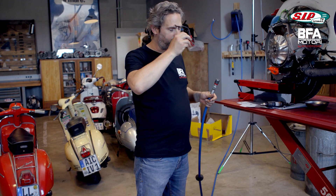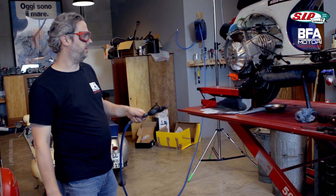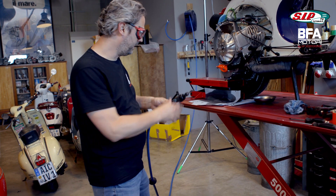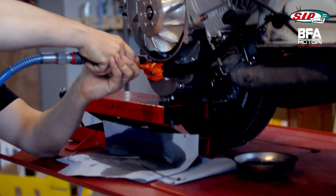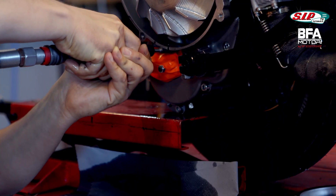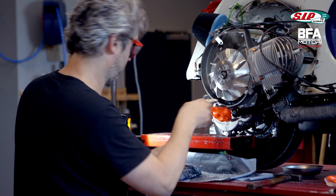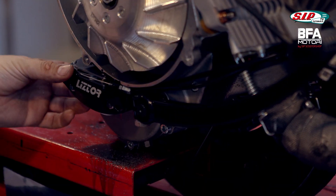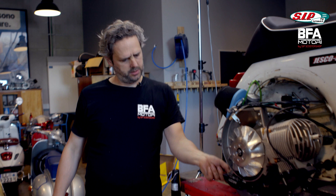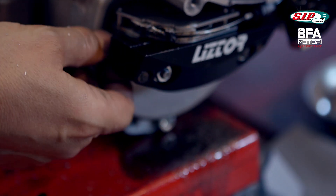Safety glasses are always important. When you've been in the emergency room and some annoyed and overtired 25-year-old medical student stuck a spoon in your eye to get a splinter of metal out, then you can appreciate protective glasses - it's always recommended. It doesn't quite pull in here because the screw is too long. Apparently the casing height of the BFA engine is slightly different than the original. The screw that pulls the pad in hits this, but I can shorten it. I'll go straight to the bench grinder and shorten it.